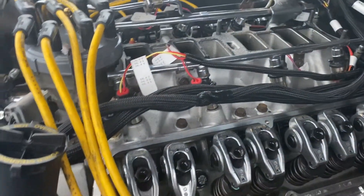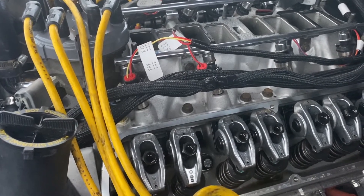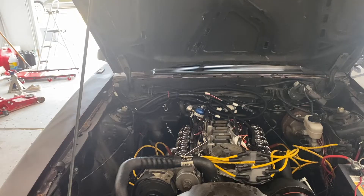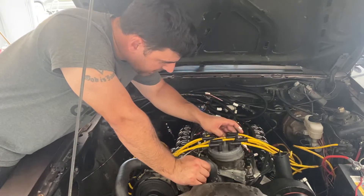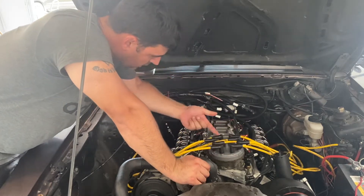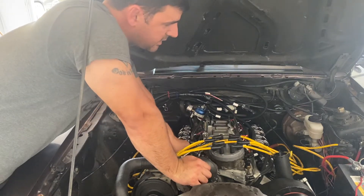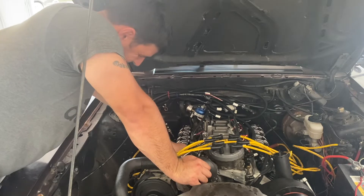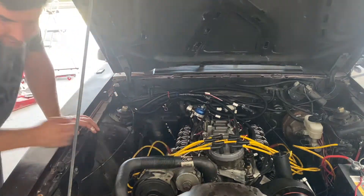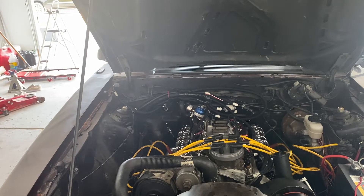Anyway, I'm gonna go through and do a quick valve adjustment. The car is kind of in limbo right now so it doesn't hurt to do a quick valve adjustment, make sure everything's tightened down after initial break-in of the engine. I've got number one at top dead center — confirmed it by taking the distributor cap off and making sure the rotor is pointed at number one on the distributor cap. So now I can adjust number one intake and exhaust. Exhaust feels a little bit loose. I'm going to throw a quick time lapse in here of me adjusting all these and then we'll report back with what I find.